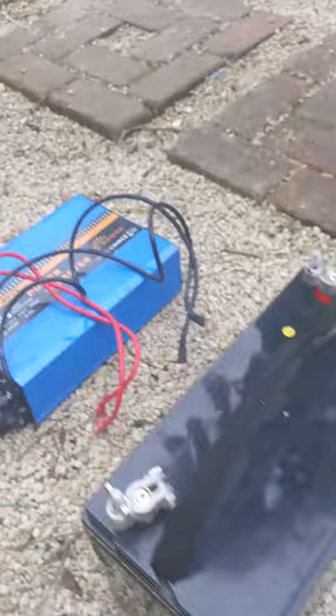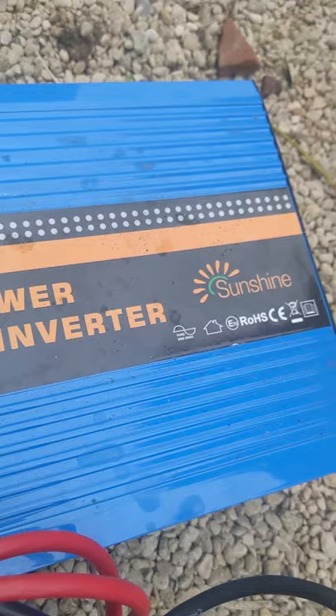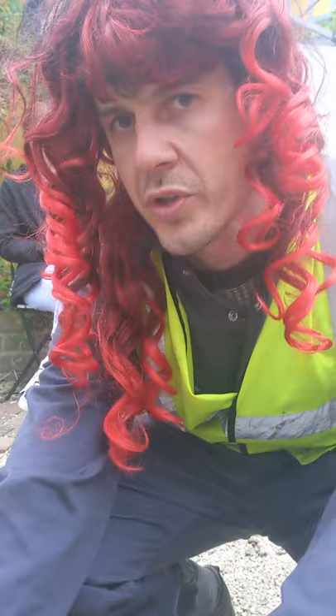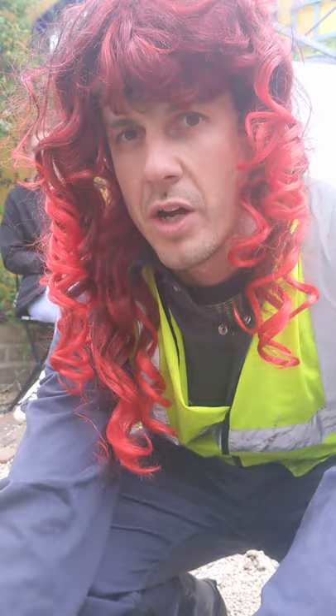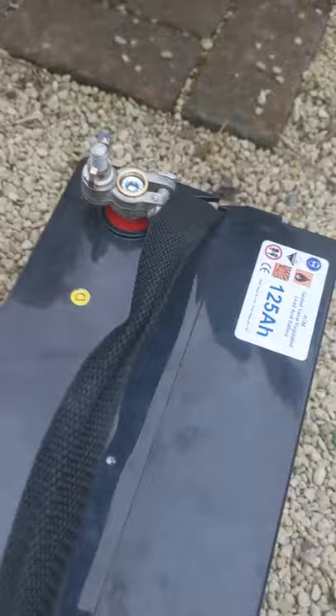Then you need to be able to invert the power, so we've got a power inverter here. It's 1500 watts, so you've got to make sure the wattage is enough for the washer you're using. For a 1400 watt washer we're using a 1500 watt inverter and it works fine — you can get them upwards of three, four, five thousand watts. You've also got to make sure it's pure sine wave so that it'll actually run the motor. Some come as modified sine wave and that won't work. These are a bit more expensive but it's worth it. It inverts your power from your battery's direct current to AC for your washer.